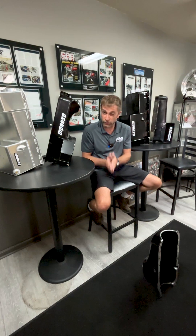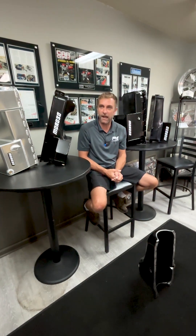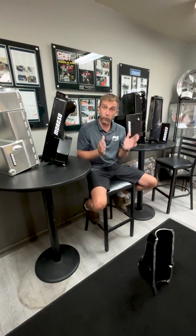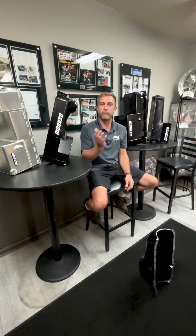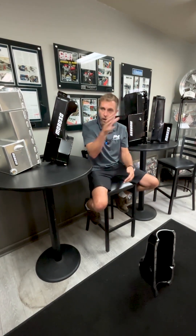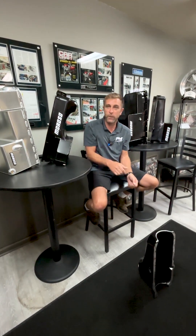What I wanted to cover is if you're looking at a custom engine or stroker specifically — a stroker engine, in my opinion and Prestige's opinion, needs to have a good aftermarket oil pan. That is for good oil control, so we can avoid windage problems. If you're not familiar with windage, that is when oil is returning back to the sump as it's draining back and gets caught in the crankshaft — or for instance, you're accelerating and all the oil goes to the back of the pan.